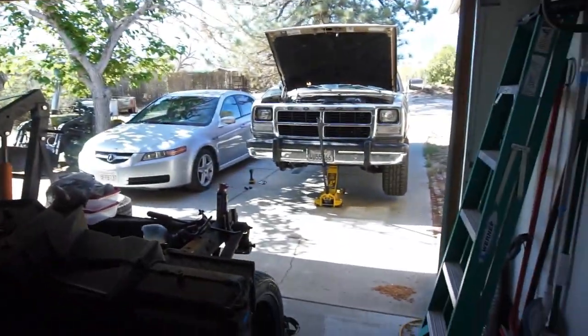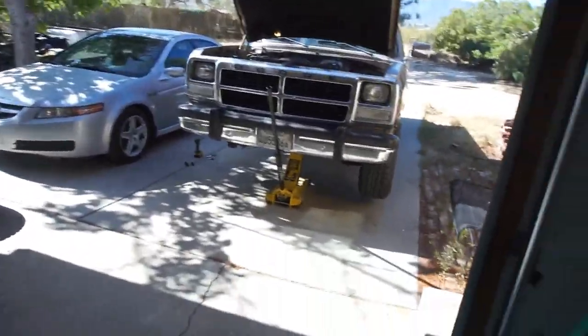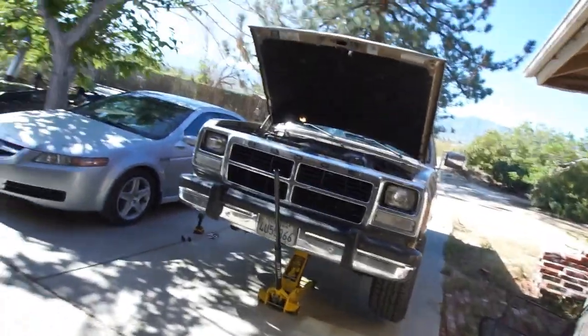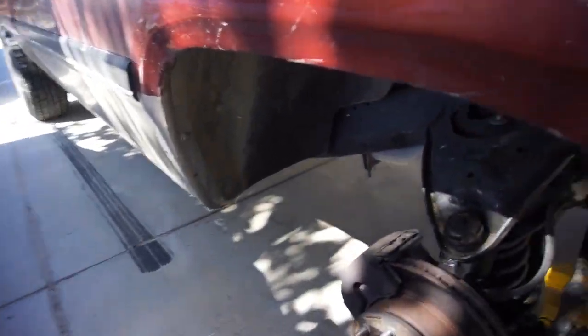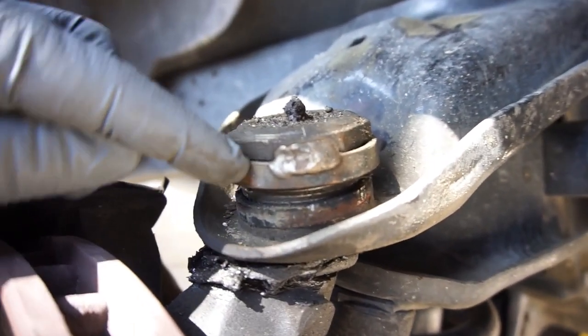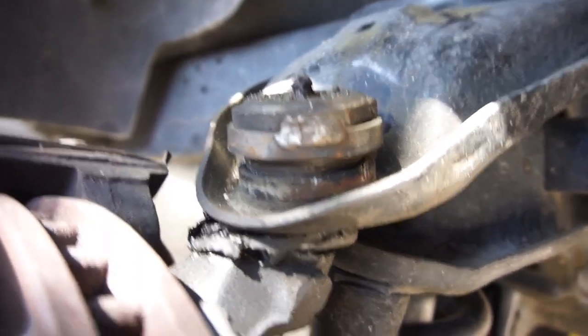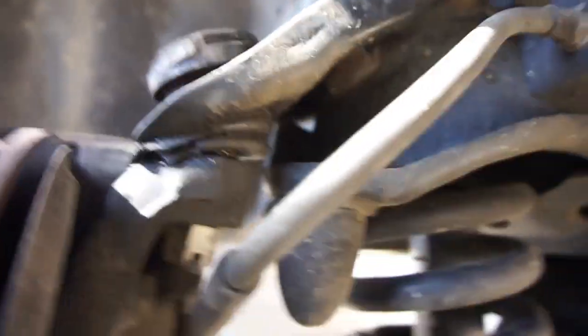I got a project today, and no, it's not working on this thing - it's working on this thing. Kid came home yesterday, comes in, and a ball joint came out again. I'm like, what? They're welded? He said yep, they came out. So this is what actually came out. This piece here - the ball joint threads into this piece. This piece is supposedly pressed on to there. So we've got a blown out ball joint again.